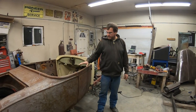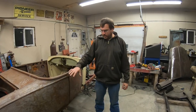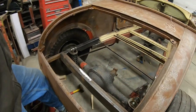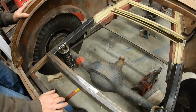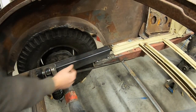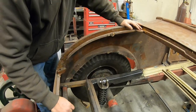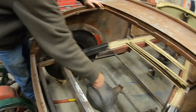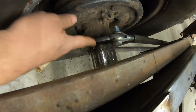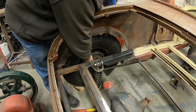So it's the next day — we've had the body on and off probably a half a dozen times just getting the rear end geometry. We'll show you what we did. Everything is just tacked in, not completely welded. We've got square tubing mounted up on top of the frame — that gave us our height for our coil springs that came with this Roadster when we bought it at the auction. We got our hairpins just tacked on. We made these brackets — made a small cardboard template and welded them out of 3/8 steel, just like the ones you can buy.